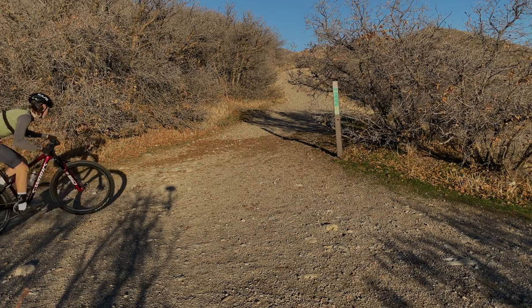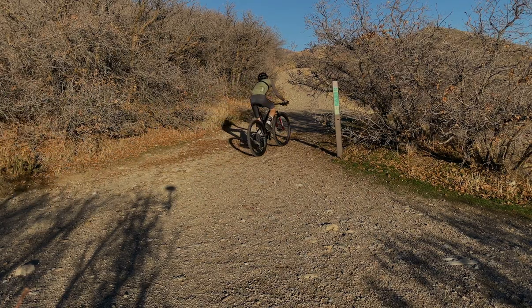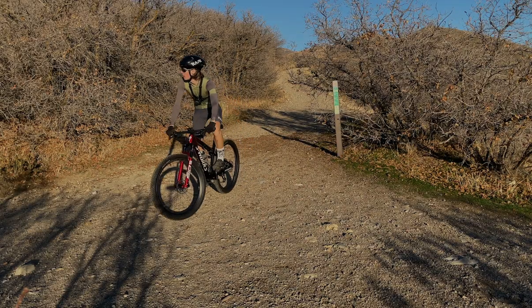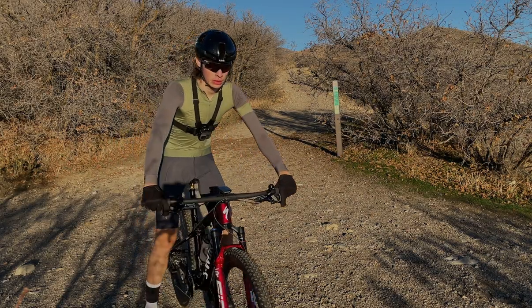It was a little weird. That head tube angle is 66.5 degrees, which is extremely slack for any bike in that range. I mean, it's got 110 millimeters of front travel, but most other bikes in that range, i.e. ones we talked about, Spark, Santa Cruz Blur, Cervelo ZFS, most of those come in a 120 mil or 100 mil platform. But in their 120 mil platforms, they're usually between 66.6 to 67.5 degree head angle. So this bike is actually slacker than all of the rest of them, which was weird.